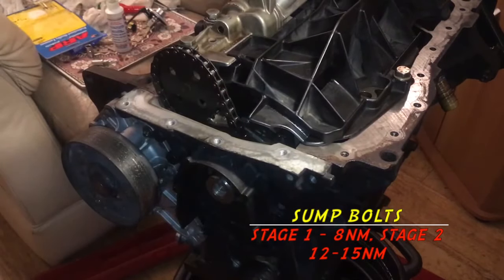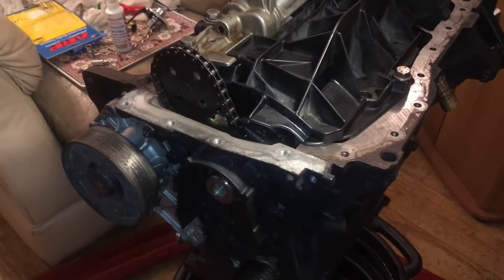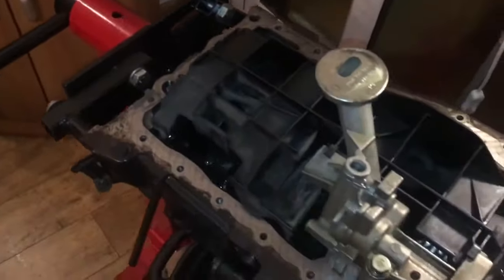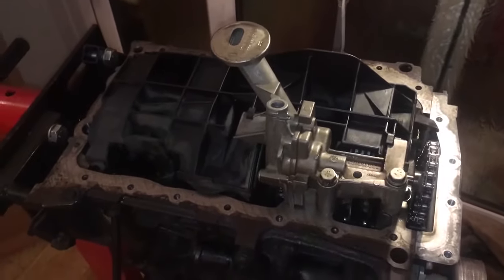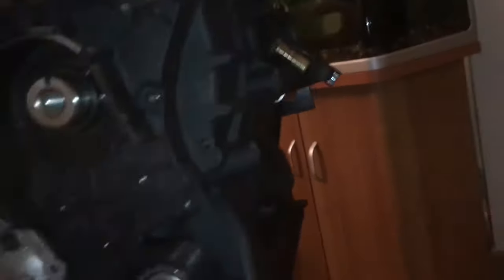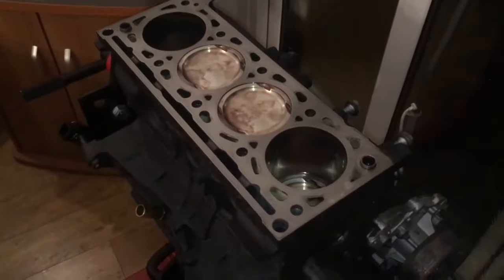I'm going to buy some nice new stainless allen key bolts because I hate the horrible star bolts. Run silicon all the way around, tighten them up — torque setting on screen if I have one. Crank seal on the other side still needs doing, but I can't do that while it's on the stand. Drop the sump on, put sensors back in, and that's basically your bottom end — voila, one full block with woodruff key, minus the sump until I get some bolts. See you next time for the head port and polish.